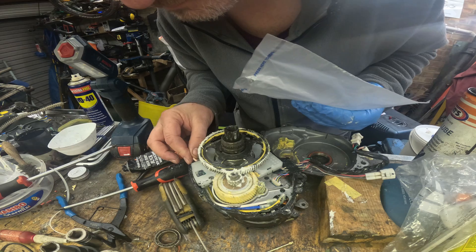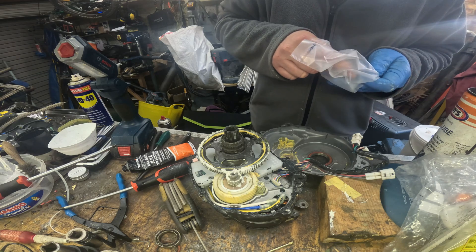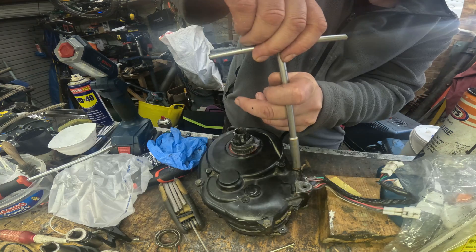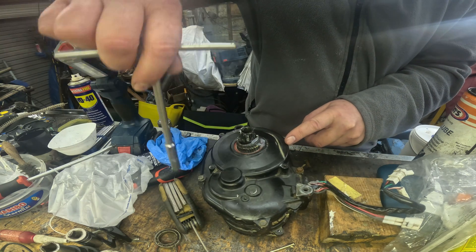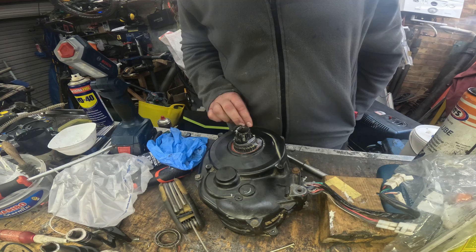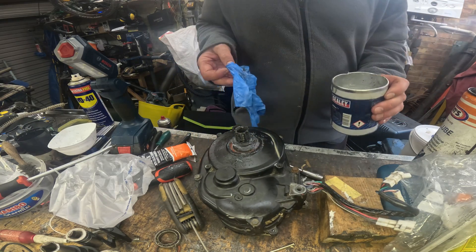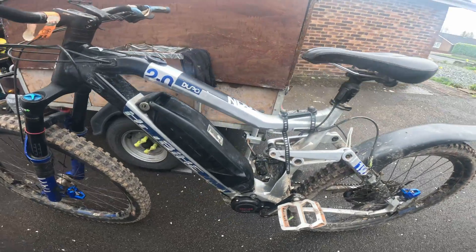Another step to be careful not to miss is the thermal pads on the other side of the board. There are two integrated circuits which lose their heat to the casing - it's important to make sure you have those pads in place. Next you can put the casing back together, tightening up just snugly initially. Give it about 30 minutes for the silicone to start going off and then do it nice and tight. Final job: put the circlips back on the outside of the crankshaft. So after all of that highly invasive work to the motor...